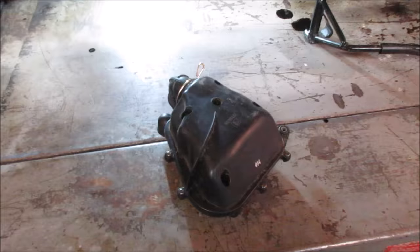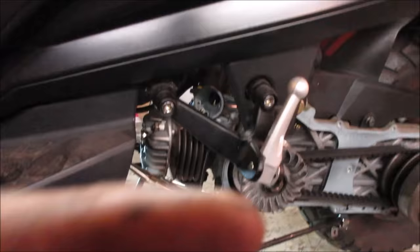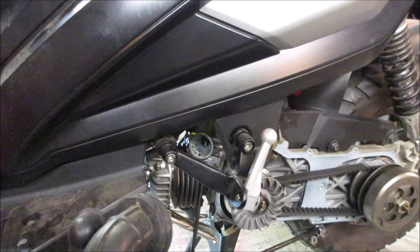Here's that air box. And you can see it goes through a bunch of baffles and a filter on the inside, and this is the intake part of it right here. So a bunch of drag is across that box. Sometimes it affects the lip of the carburetor right here on these ports coming in, how much is being fed into it. It kind of directs the air and causes drag too. Causes it to, say, choke the carburetor. Let's go see.